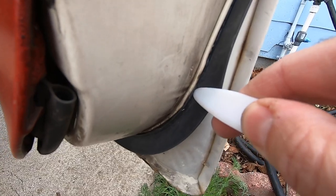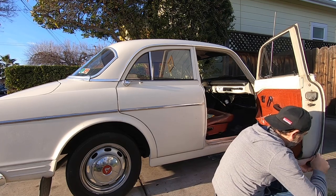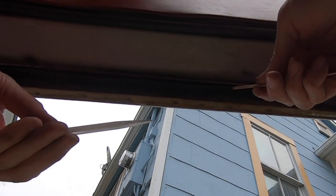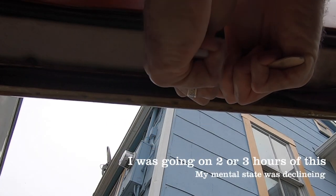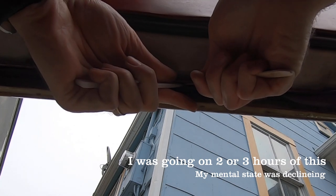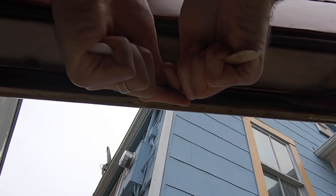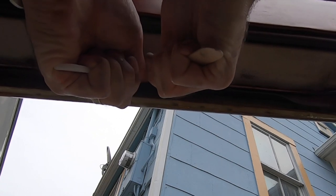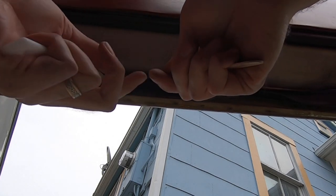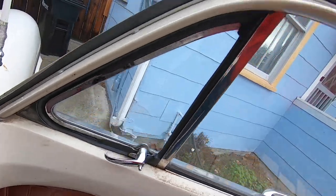I've been using this little tool to just jam it in there. I developed this technique where I use a tongue depressor and my trim tool — kind of push and poke. I'm just making this stuff up because the service manual literally just says 'pull out old seal from track and push in new one' — it's like two sentences. This isn't something that mechanics really keep track of.